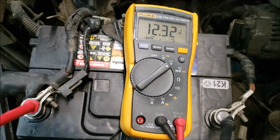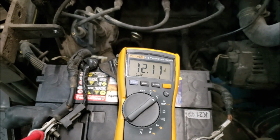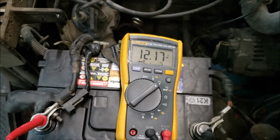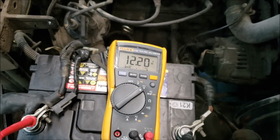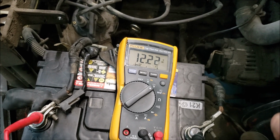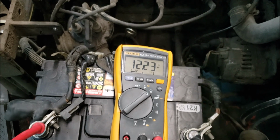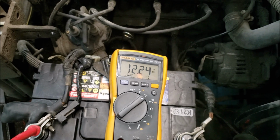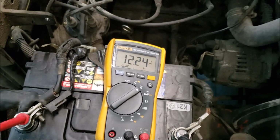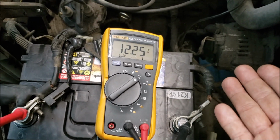Okay, crank it. Okay, 6 volts it dropped down to. Tech came in first. As per the report, same thing was happening. 4 volts voltage drop on the battery, right? Installed a new battery, dropped down the same, 8 volts. Suspected a bad new battery, had the new battery tested fine, put it back in, same problem.